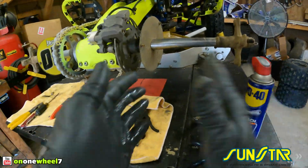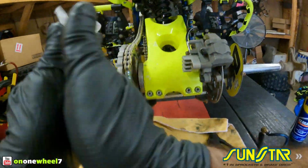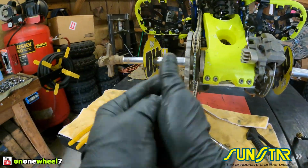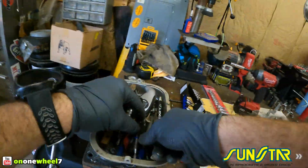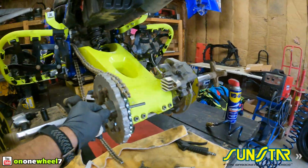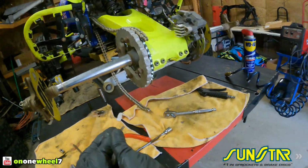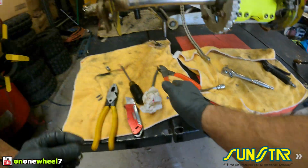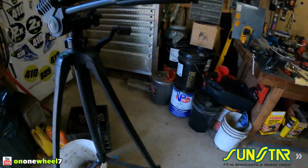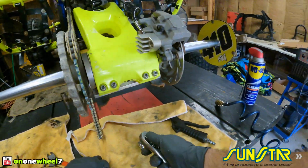It's always nice to have this stuff with you if you're close. Keep this Allen wrench and your carrier tool. The stock one, you can actually just use a screwdriver or an Allen wrench like that, but this is an LSR one, so we've got the little holes like that. After a ride, you want to recheck the slack and tighten it up a little bit, because they will stretch. So we will loosen this.